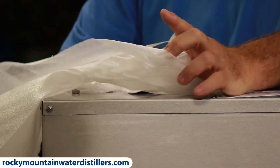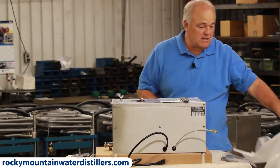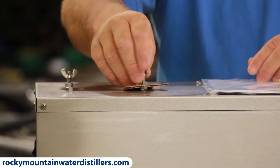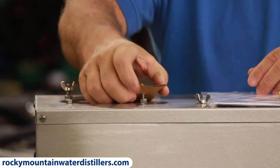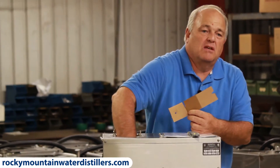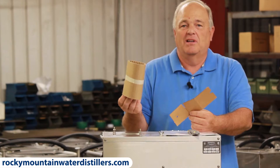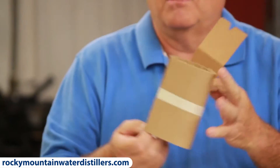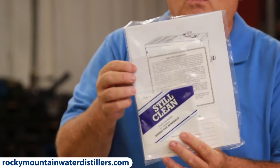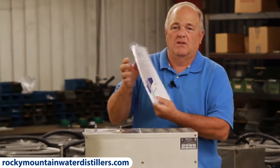Slide that out, pull that out — the lid's upside down on it. Take the lid out and put it over here, and then all the foam comes out. Now this next step is very important: you take this wing nut clear off right here. A lot of people forget about this. There's a piece of cardboard down in there holding the float from bouncing around during shipping, and there's also a piece of cardboard underneath it. You pull those out — or you may have a little fire when you turn your heating element on, or your boiling chamber will be full of wet paper. So pull these two things out of the boiling chamber when you unpackage it. When you open it up, you have a sample of SteelClean, your warranty, and all your manual right there in a package. Save that — do not discard it, you'll be needing that.